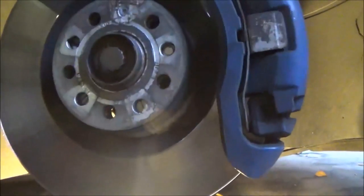So you can push the sway bar down a little bit and get a little movement out of it. Or I could just take this VW jack and just lift the wheel up. I'm awfully zoomed in now, but you can see the sway bar end link there in our progress. And now you just, boom, maybe a little bit more. And boom, we're in. So we'll just throw a bolt in that, tighten her down, and that's how you get your sway bar end link into position. You can use three jacks because you want the front end of the car off the ground, and then just use another little jack under your wheel and you're good to go. Always learning. That's the fun part.